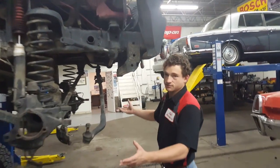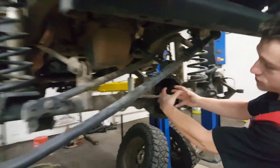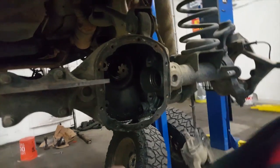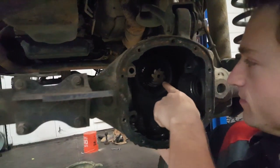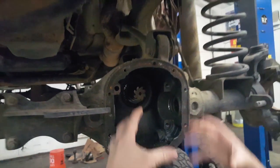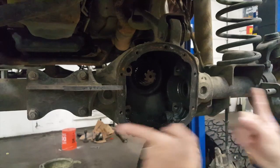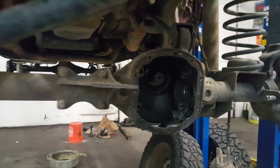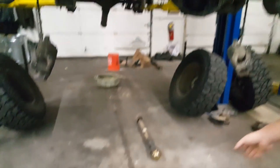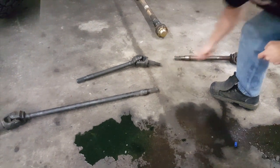Inside the front axle assembly, which we currently have completely stripped down, the front differential carrier resides in the center. Where this pinion gear rotates from the drive shaft, the carrier sits in two bearing halves to rotate and spin both axle shafts. We have both these axle shafts present on the ground in front of us. They engage on splines where they slide into this carrier.